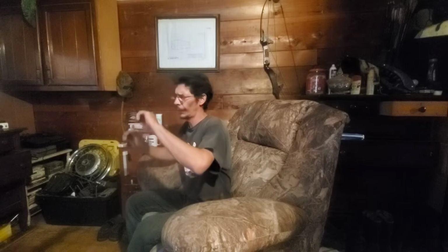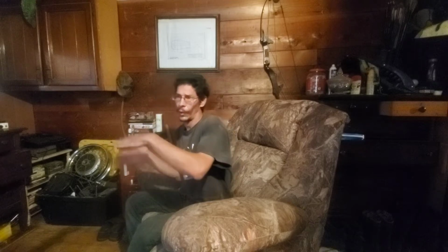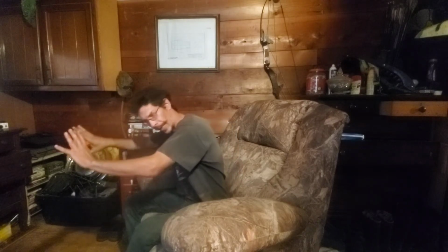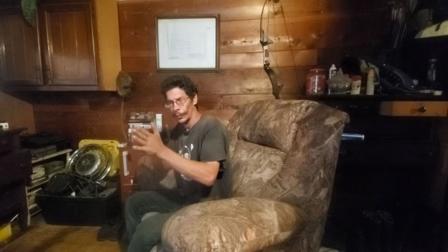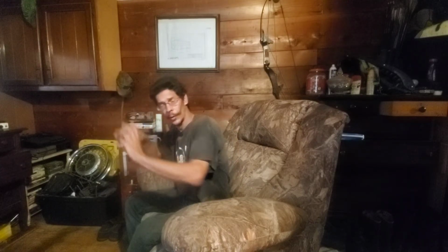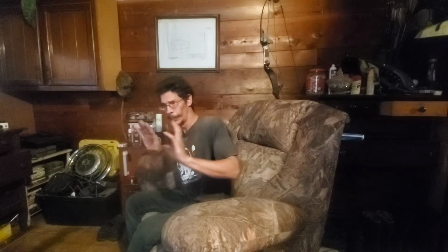And be sure that you keep your stack in order and in the right direction. So when you take a piece off, pull it off, and then flip it over and put it down. When you're done with that steel, make sure that the rounded teeth edges are facing up and out when you put the stack back in. There's one side that's going to be really flat, with some sharp edges on those little teeth grooves where they go onto the basket. The other side, you'll feel, is kind of rounded. Make sure that rounded side, with all of them stacked the same direction, is pointed out when you put the stack back in.